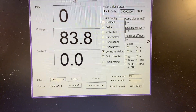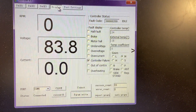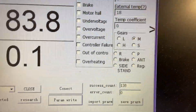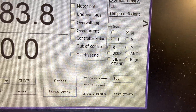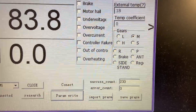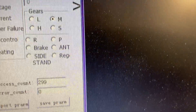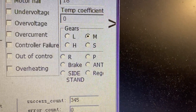Here's the display right now. The voltage on my bike is the same — I'm not running a display, but that's my volts. It says controller failure because I didn't move the wheel, but see that — it went away. So now there are no faults at all. You can see the gears here: it says medium, high. It goes to low — maybe my switches are messed up, I'll have to fix that. Now when I click the button it goes into sport mode, then back to medium, high, medium, low. It's not going to low right now — I'll check the wire, no big deal.